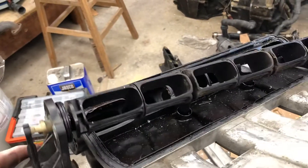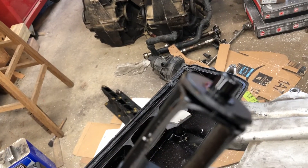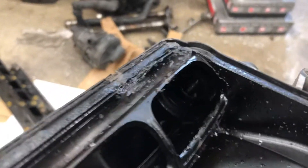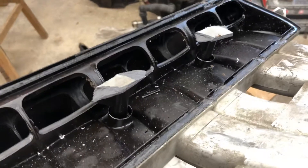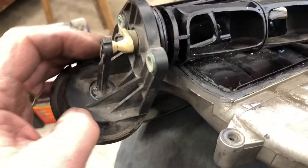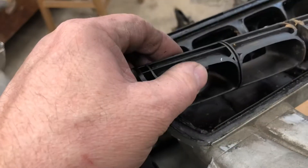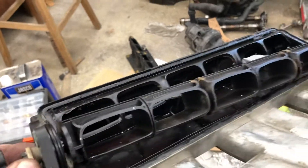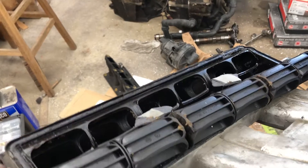These are all the service parts. At the end of this, there's that surface which rides in a bushing — it's down at the end, you can barely see it. There's another bushing over here, and there's the diaphragm. There's this little arm that sometimes breaks, and then the flap valve itself is able to fail. It's not the flap valve's fault — the bushings go, and then this flap valve rattles around in there and gets beaten up, and sometimes it has to be replaced.